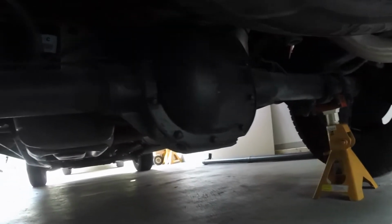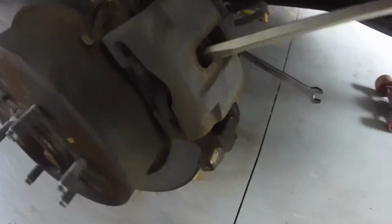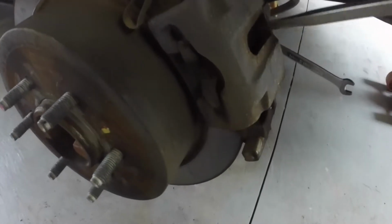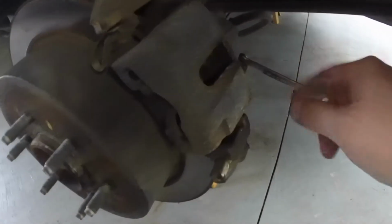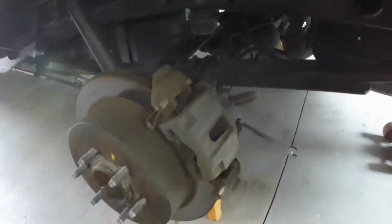the ground. To make the ease of the caliper coming off, I put a screwdriver in here in between the rotor and the caliper and just kind of pull the caliper, which I've already done, until you don't have the pads on the rotor anymore, so you can lift this out of the way. Once you undo this bolt, I'll set the caliper with the pads up